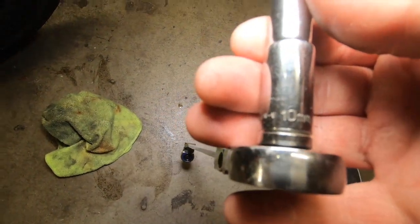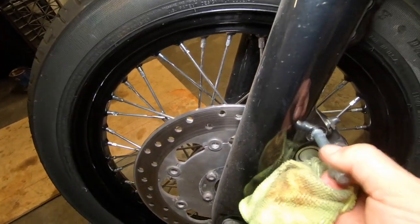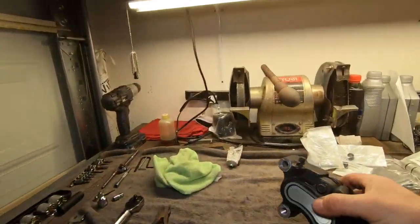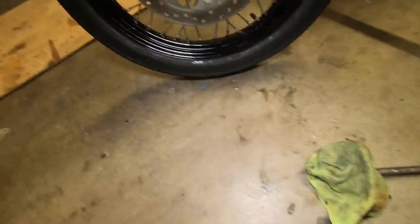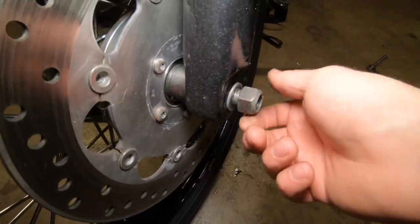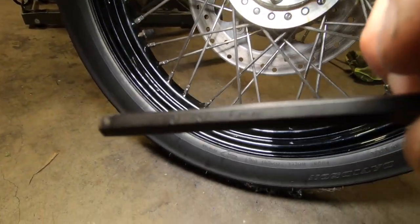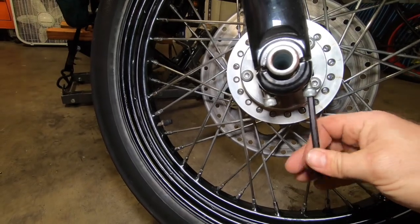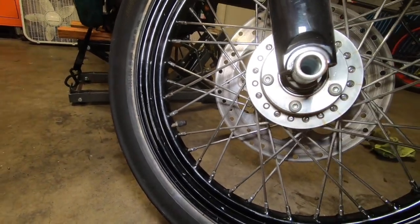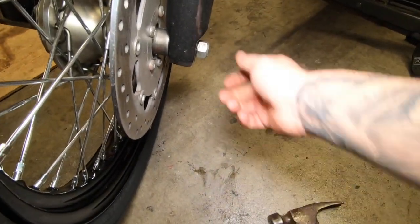The V-Rod setup looks about an inch lower, but with my dampeners in it I actually extend it to a full range of travel. I'm removing everything — the bolts, taking out my brakes, and I'll be using different brakes. I got a pair from trikes and baggers, I think from like a 2010 or maybe a 2014 trike. I got those brakes on eBay — the whole dual disc setup with brakes was like $100–$110. All I had to do was rebuild and clean them; they were actually good to go.